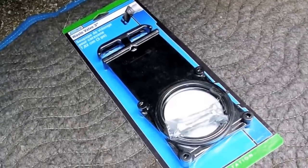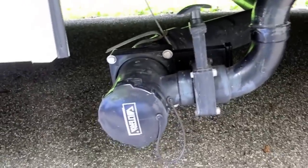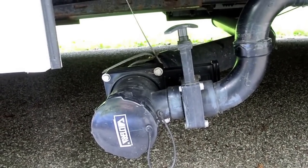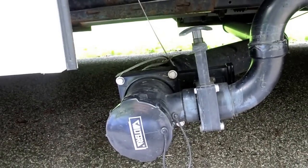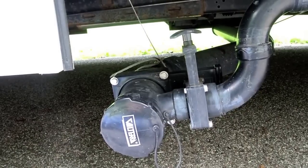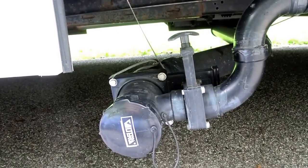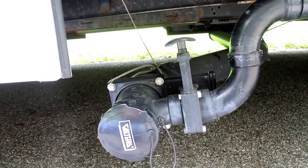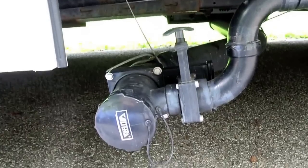I'm having to install a new 3 inch waste valve into my sewer system here. I was using one of those flush out type of adapters — the kind that you put a water hose in and it blows water up into the holding tank. I left the water pressure on when I inadvertently closed the holding tank valve and it blew the end of the holding tank valve out.